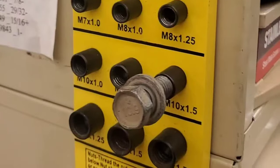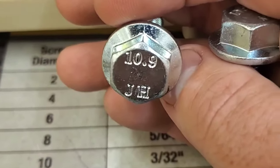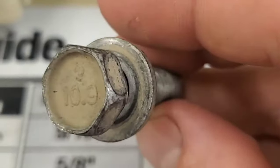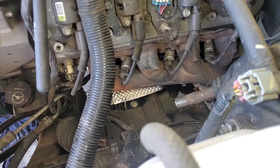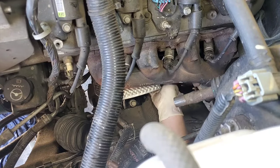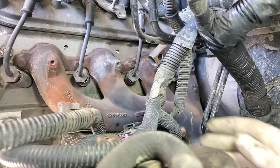Went to the Ace Hardware in the morning. Found the size bolts I need there — look at these nice little trays Ace Hardware has. That's the exhaust manifold dust shield bolt, and the bottom one was that engine mount bolt. Always get the 10.9s — 10.9 is what's stock. Those are the metric heavy-duty bolts for automotive applications. Get the engine scooted back up and finish putting your bolts in. Don't forget to tighten those down — I don't know the torque specs on these. Good and tight or sure and snug.